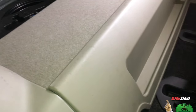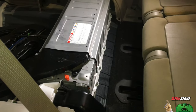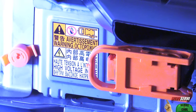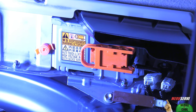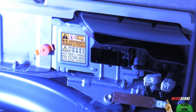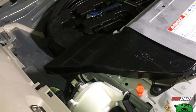This just pops up out of here — gotta muscle it a little bit. And there you see the most dangerous thing in the universe exposed for all the world: the high voltage hybrid battery. This to mortals is like kryptonite to me, so steer clear. Even though this video is for entertainment purposes only, if you're crazy enough to do serious work on your hybrid battery, this little orange doohickey can reduce the risk of injury or death. I just grab my handle, swing it out, and it cuts down the voltage like a circuit breaker.